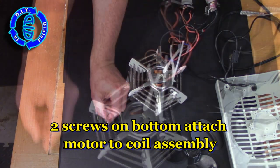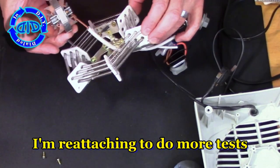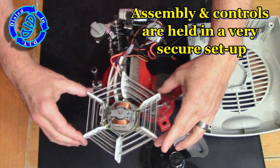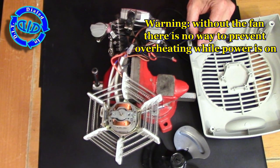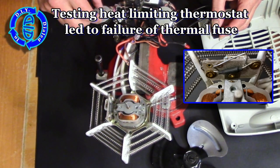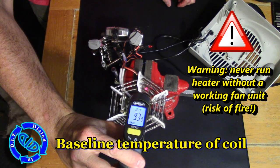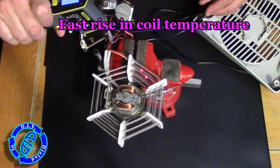The fan motor is really easy to separate from the heating assembly with just two screws on the back side. However, if you want to completely separate it, you do have to cut the wires that run power to the fan. If you have any ideas about running a heater like this outside of its case, I suggest that you secure it, but I don't recommend bypassing the safety components — which I'm about to do in order to run all of my tests. I'm only going to run this for a short time outside of the case and would never walk away from it. I'm not bypassing the tip-over switch, because that is one way I can immediately turn off all power. On the exact opposite side of the thermal switch is a thermal fuse, and my first set of tests caused that to fail — once it fails it can only work once — so I had to bypass that as well in order to get the coils to heat back up.